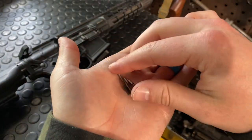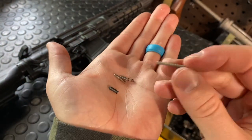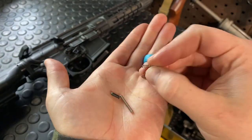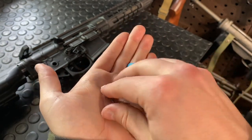For the little bits in the bag, we've got a few things. There's a new detent — Radian calls it a 'missile' — that's Radian spec, as well as the detent spring, so you can swap those out with whatever was in there before. And these two little spring-loaded plungers are actually for the selector drum — they're what hold the paddles in place.